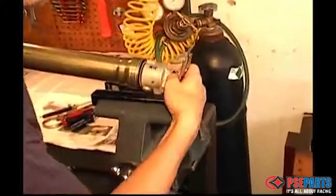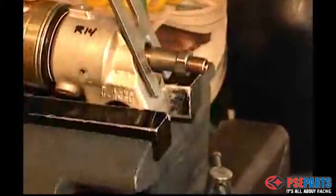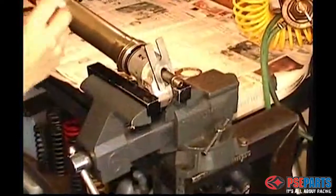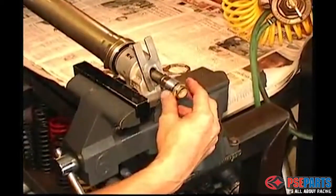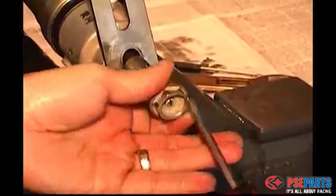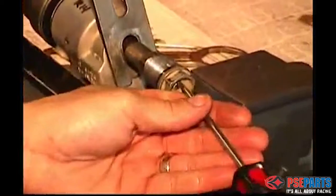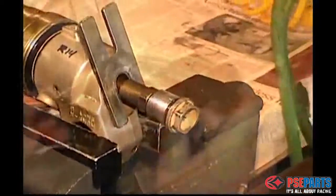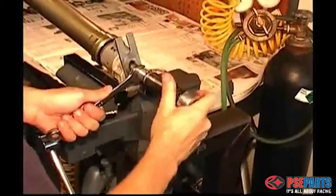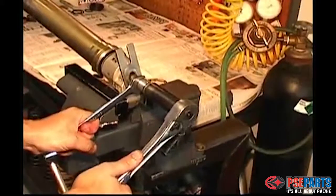As you push inward on the fork tube, you pin it, and that will hold it in place while you reinsert the damping adjuster extension, and again turn the damper to the left and tighten the cap screw down, and then you're ready to tighten down the damper assembly, the bolt to the lock nut using the socket and the open-end wrench.